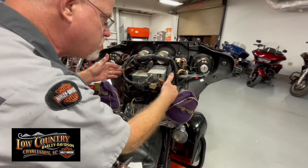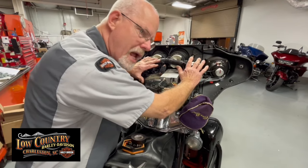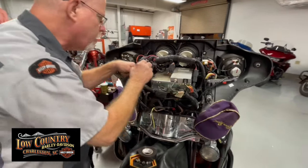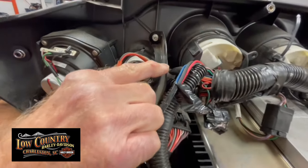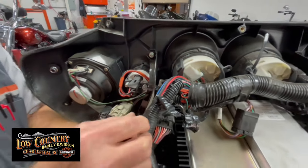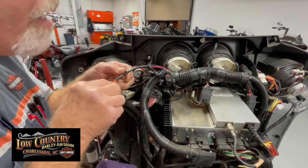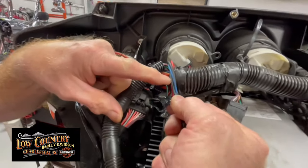So now I take the fairing off, because I know there are two metal braces on early models and the wires are pushed up against them. With age and vibration, things can move. Sure enough, over here I see — I hope the camera can see it — a little notch, something that's not painted black, something that tells me something's been rubbing here.